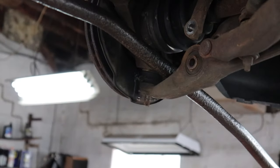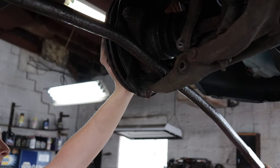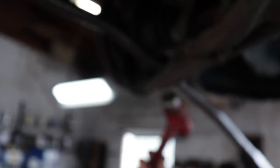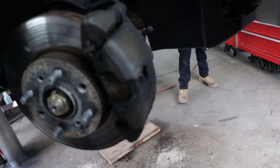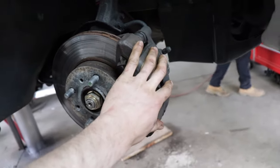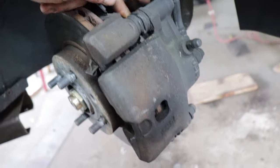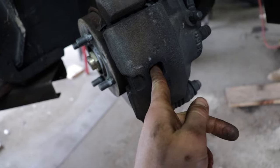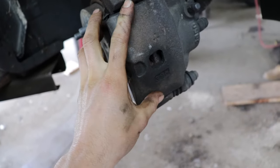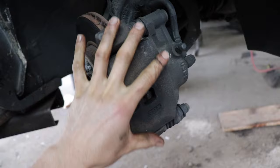If you got a big bar like that, it works best — you pry on it. But this one's going to need a little assistance with the hammer. Tenderly hit the joint. Now we're not doing the order of importance here — we did bust the bottom loose. Take the axle nut out, take the brakes off so we don't have any rotor and all that jazz going on. Instead of taking the caliper off, you could take the whole assembly — just take the bracket off with it and pry on the rotor and caliper a little bit to release the piston so it slides off and back on easily. Because if you pry it off and don't release the piston, it's a real pain to try and get the pads back on the rotor.